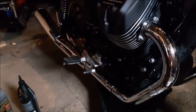I'm going to dump the two oils in and drain the rear end at the same time. The rear end had a lot of black crap still wanting to come out of it, so I sprayed a tiny bit of brake cleaner in it and then put some oil in to help flush that through. You can see here — that's the kind of stuff that came out, still kind of dirty but should be good. Everything else is ready to go, just got to snug up the transmission filler cap, and I'm going to fill through the little breather tube up here.